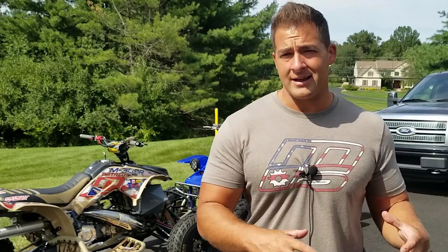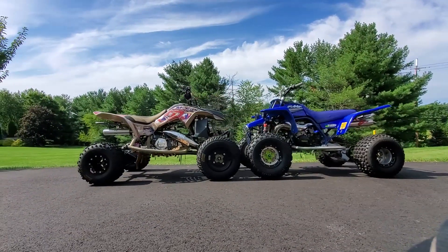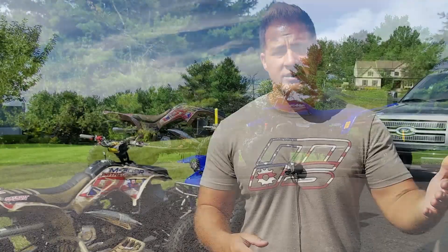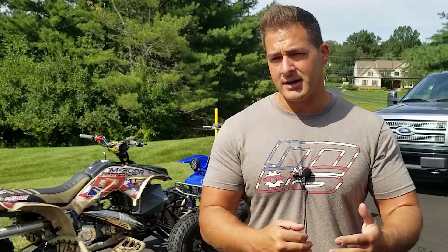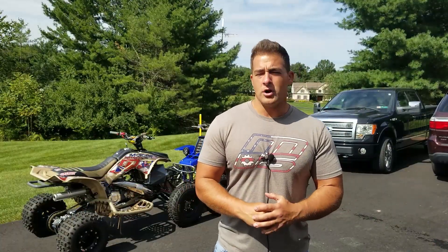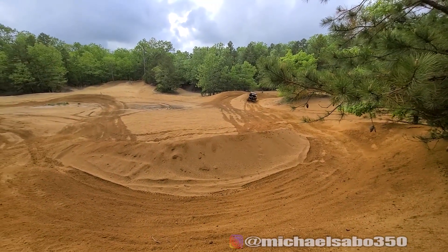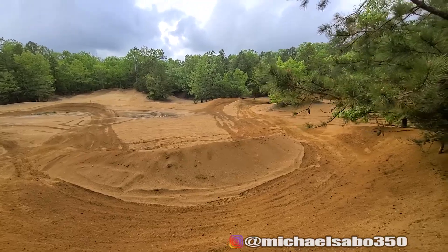I know I said I was going to be going riding this past Monday — unfortunately I couldn't get anybody to go with me and places to ride are not exactly right down the road. Hopefully this Saturday — I think Jason wants to come ride with me — we'll take it up to the coal mines, which is a known spot for testing and making sure everything runs right. We'll have some riding footage with the 250R. Also, we heard some weird sounds coming from the transmission on the Maverick — I think we have a bad bearing in there. I found a way to pull off the side cover and I don't think we have to remove the transmission.